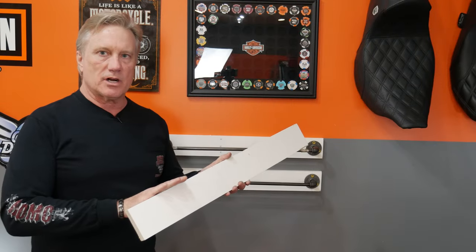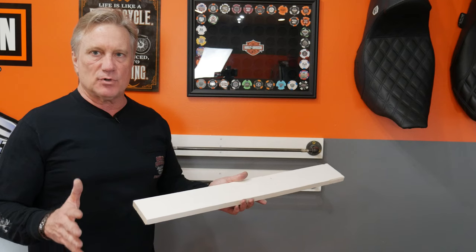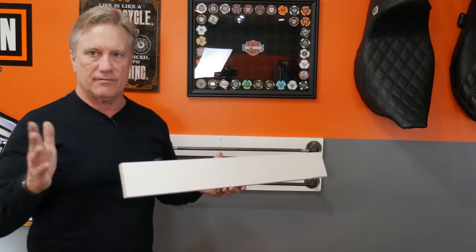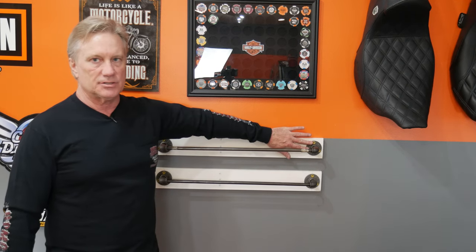Since I couldn't find that product or anything else in the marketplace that allows vertical storage versus horizontal, I decided to make my own. I'm going to show you how I made it — not step by step construction, but I'll show you on the wall, give you the dimensions, and put links in the description to all the materials. I purchased enough material to make two full racks plus another rack for my luggage racks and passenger backrest for about $70. I started with an eight-foot piece of one-by-four primed board — I got this at Lowe's for around $10 — and cut it to a length of 27 inches, which allows me to mount a 24-inch rod along with the floor flanges.